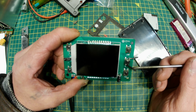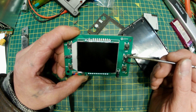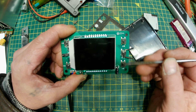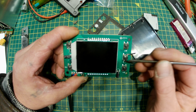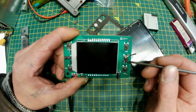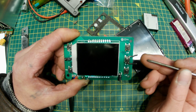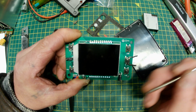I use the GSM switch — you can set them so that when you send a text, it texts the relay and turns that switch on for two seconds to turn it on, then it turns off again, and that starts it up. When you turn it off, you've got to set the text message for four seconds or more to turn it off. The website where I got the timer from — I think it was gsm.uk.net — I'll get that and give you the details; it tells you exactly how to set up the pulse for the heater signal.